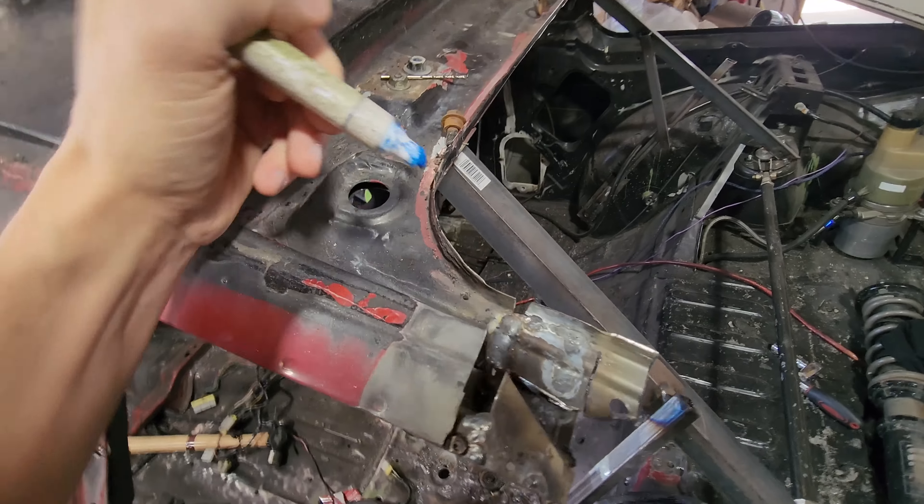We have the skin test fitted once again and the B pillar is now ready to go. For the C pillar, we trimmed off the rear with all the previous welds. The middle layer here is the C pillar skin — there's the outer quarter panel, the inner C pillar skin, and the bottom roof reinforcement which is not present here. I did drill out the spot welds to that roof reinforcement — it was super rusty for some reason. With this lined up, I'll draw a line along the end so I know how much material I have to work with and where to trim the panel on the roof. Since this panel was cut the same way as the C pillar, I can just outline the C pillar directly.